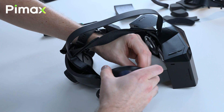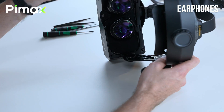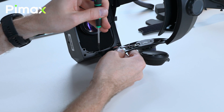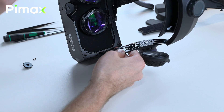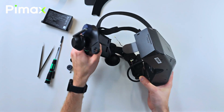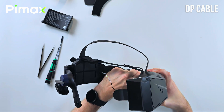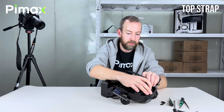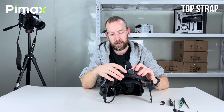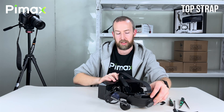Then let's also remove the back of the headset. Let's first unplug the earphones — that's two. Then let's take out these screws here. And we can also take off the DisplayPort cable and the top strap. This one is harder to get out. This one delivers the power from the battery to the headset, and this electricity cable is going through here — we'll take a look at it later.